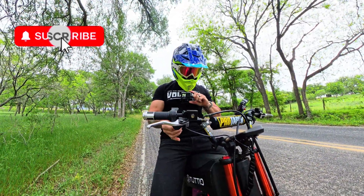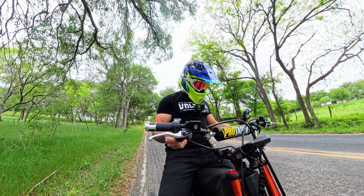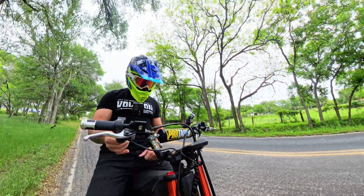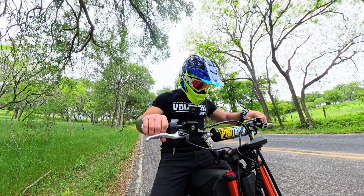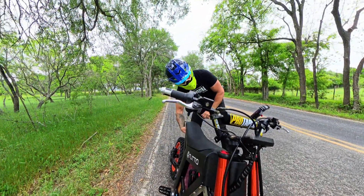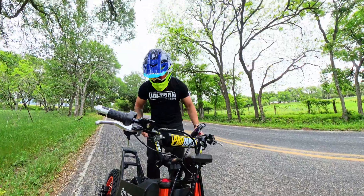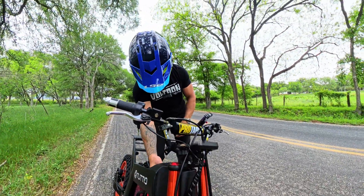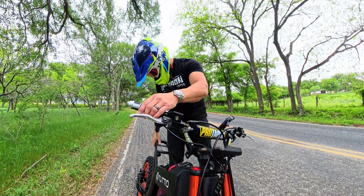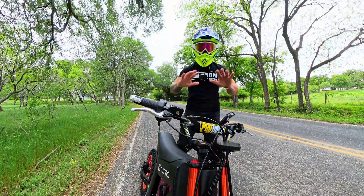The power disappeared — I don't know what happened. Let's cycle the key. We got to 44 and a half, 45 miles an hour, and then no power. Let's unplug the battery and plug it back in to see if that'll work. There's the battery down here — unplug it, give it a second, plug it back in, turn the key back on. We got power, we got motion. Let's put it all back together and run it back.